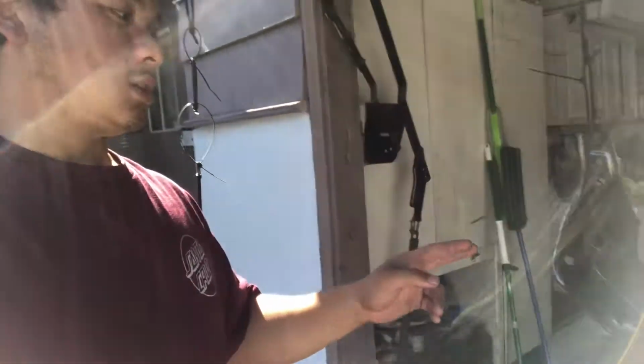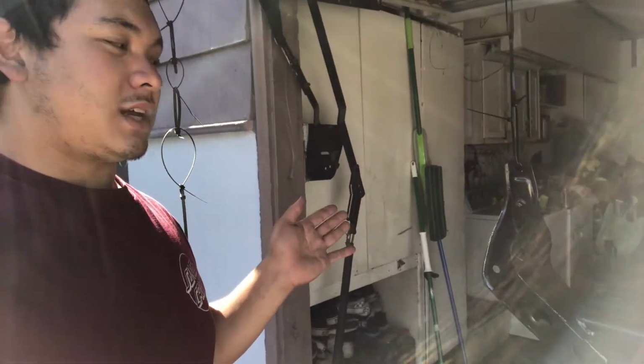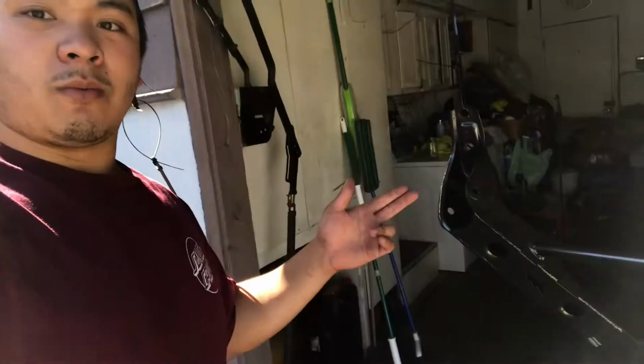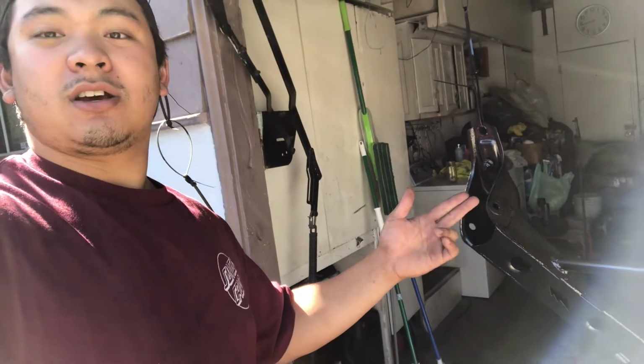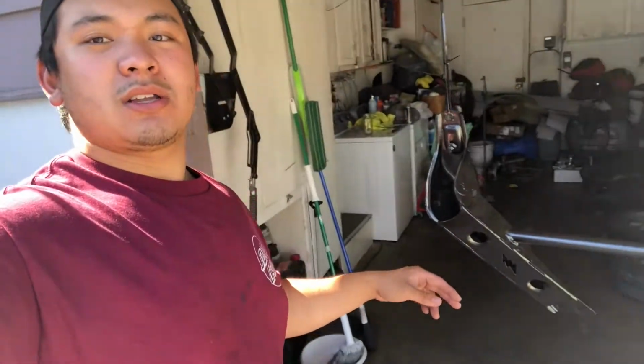The tie rods are pushing against the control arm, against the knuckle, which in turn pushes the control arm as well. And with weak tension rod brackets, I should say, with all the tension and force that the tie rod's putting against the control arm and wanting it to move, it's gonna push the weakest spot, which could be this spot in your case, and then this could bend and flex slightly, which will give you a slight weird feeling in your steering wheel. So having these blocks should be enough to get rid of all that slop and play, but having this connect to each other just gives it a little bit more rigidity and makes it a little bit stronger. So if I can find the video, I'll go ahead and put it down in the description.